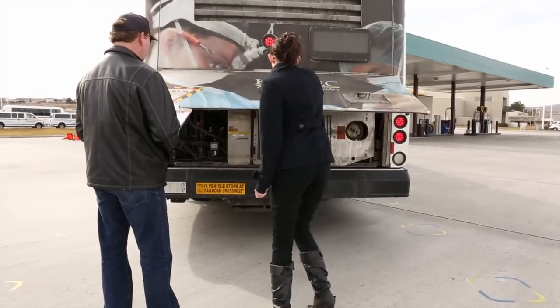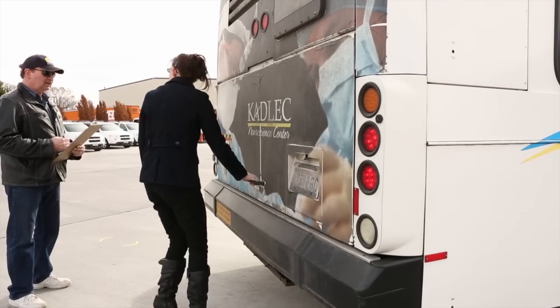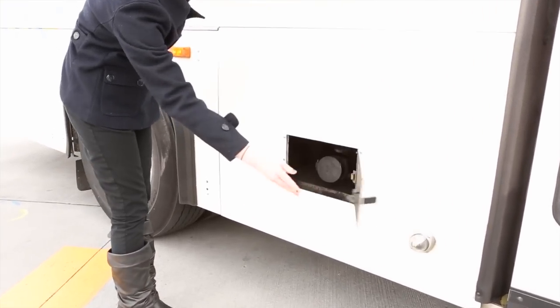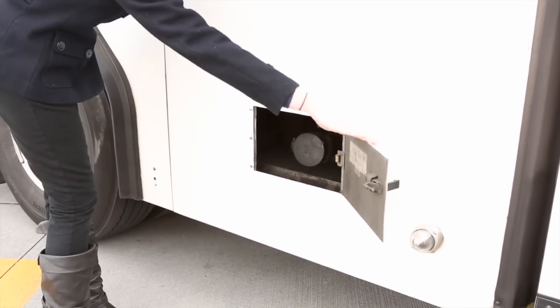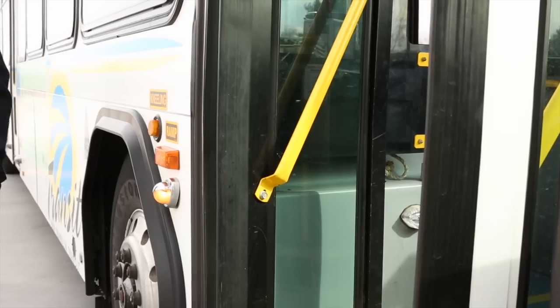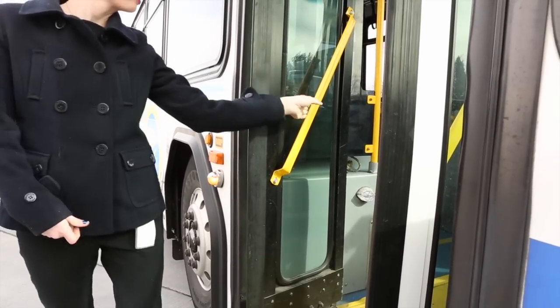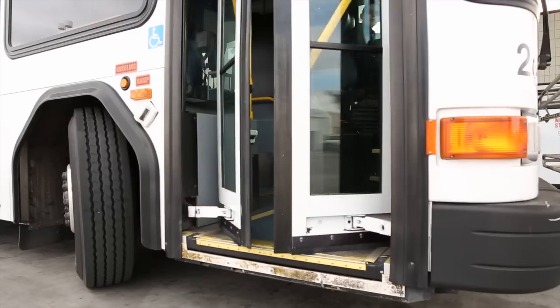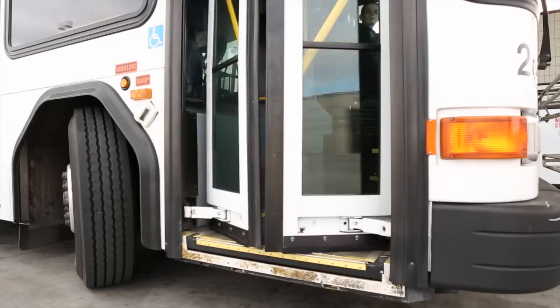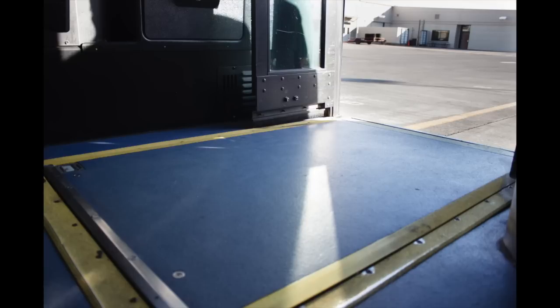Close the engine compartment and proceed to the curb side of the bus. Check the fuel tank to make sure it is securely mounted with no missing nuts, bolts, or mounting parts, the cap is tight, and the lines are not leaking. Make sure to check the handrails and be sure the hinges are secure with seals intact. Check the entry doors to be sure they operate smoothly, are not damaged, and close securely from the inside. Check the entryway steps to be sure they are clear, the tread is not excessively worn or loose, the step lights are working, and nothing is blocking the aisleway.